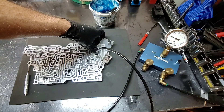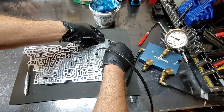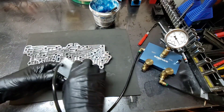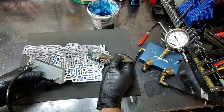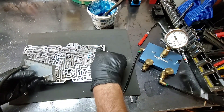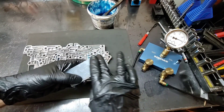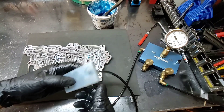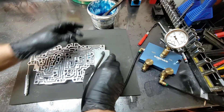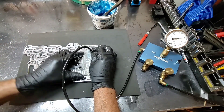See that — it's giving me a perfect seal on this one. This is my best one so far; this other one not so well. You always have to make sure where the worm tracks go and spread the assembly lube a little bit to make sure you have good contact and no leakage. I always try to put it right above the spring.